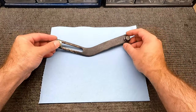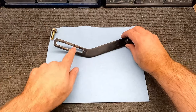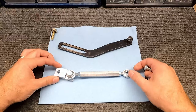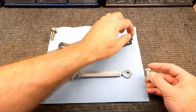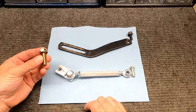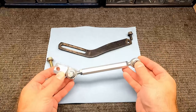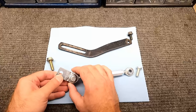Here's the linkage system that was on the car — the bolt that attaches on the water pump, and the bolt that goes in the alternator. We're going to want to hold onto that. You can see how it's got that shape to it — the alternator slides along this track and because of that shape, it gets everything out of the way of those fan blades. My new setup uses a longer bolt for the water pump since it's thicker, and we reuse the bolt from the alternator. There's also a fine thread bolt so we can get plenty of grip on this piece.